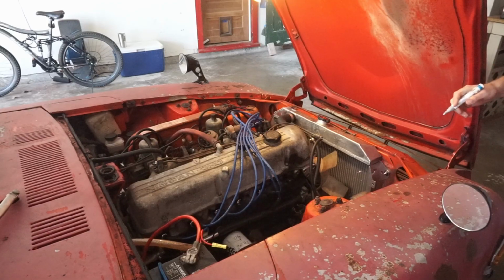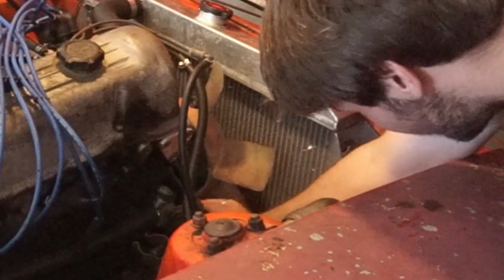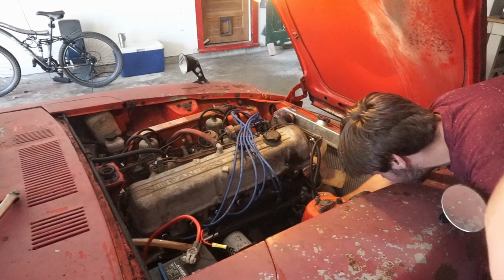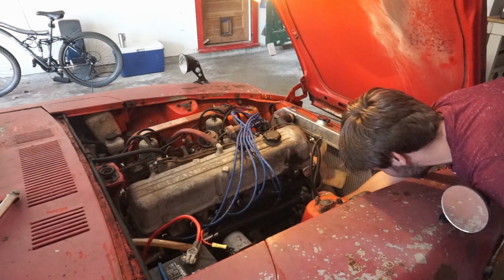That's it? That's exact. That's when it started to suck. Tiny 5 degrees gap between blowing and sucking. That's right there, that's when it stops. It starts sucking at the first mark, the top mark there. But that's when it stops blowing and isn't sucking yet. So yeah, top dead center.